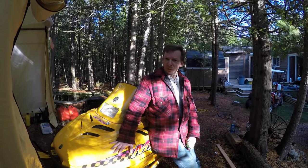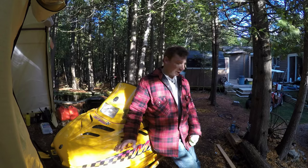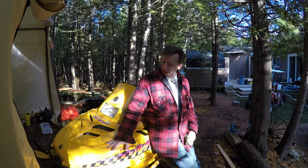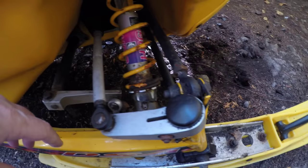I'm going to begin by washing the sled front to back. I'm going to take the power washer and blow all the crud out of the front and rear suspensions. We're going to check the sled front to back, grease and oil a few key areas, and I'll show you what I do to get ready for the season. I'm going to make sure I hit these areas really good up front — there's a lot of grime — and I'll blast all the old grease and dirt out and regrease that.